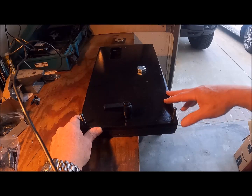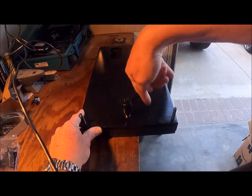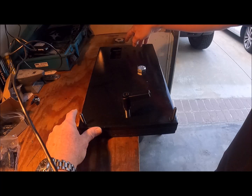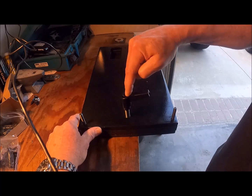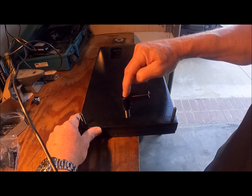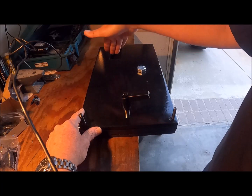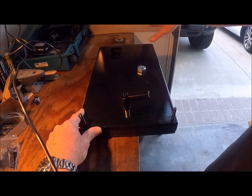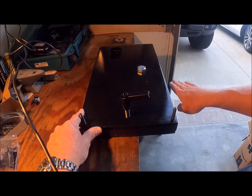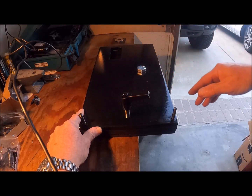Going through the top plate — there's the lock handle I mentioned. The threaded hole up here is no longer necessary; that was from when I tried to put the handle in the front, but the up-and-down mechanism was in the way. So the handle goes in the back. You'll also notice a window cut into the plate — that's so when the suspension seat works, the shock can dip down in there. When swiveled around, it dips down off to the outside of the plate. Both the second layer and the top layer are cut with a window so it can still articulate the way it's designed to.